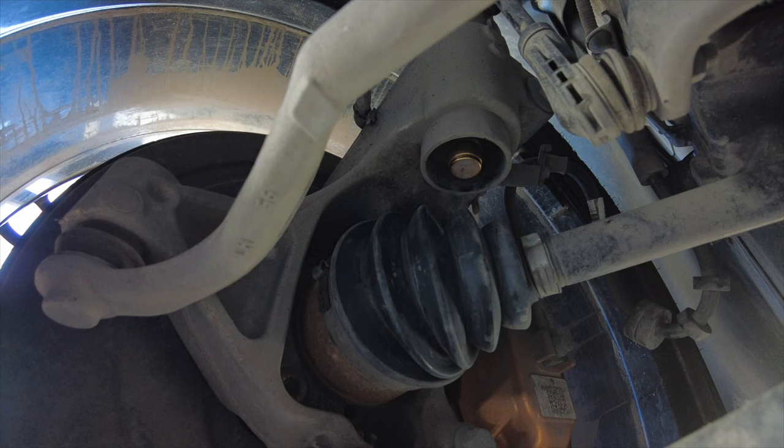What you need to do is rotate the knob clockwise first to reach the end of the adjustment position — basically position zero. When you feel the resistance and it doesn't click anymore, you shouldn't force it. Bring it to click one and then counterclockwise, as if you're unscrewing a screw. You will rotate and feel or hear the clicks. For this adjustment I am doing, I will count eight clicks for every damper.